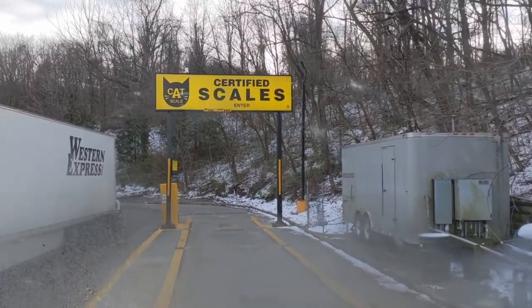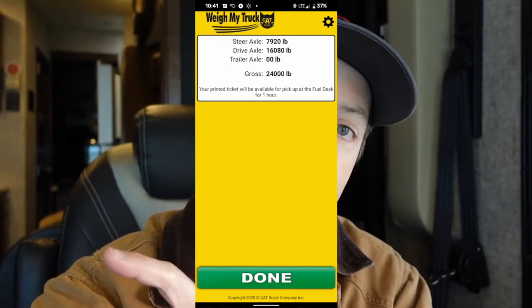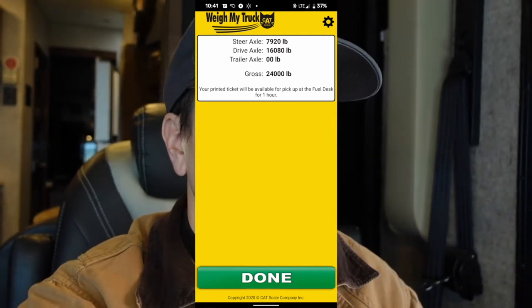When I went to the tire manufacturer's website, I found a chart that showed me based on the weight what the recommended tire pressure should be. Here's the key: you need to weigh your coach. This is a good safety thing to do anyway so that you're not overloaded. It can be as simple as finding a Cat Scale — a lot of truck stops have them, there's an app you can load on your phone. I drove up to the Cat Scale at a truck stop, pulled open the app, parked on the designated spots, hit the button, and I got my weights. What I discovered was, first of all, that I'm not riding overloaded — but second, that I took that weight, compared it to the chart on the tire manufacturer's website, which in my case was Michelin, and I'm pretty overinflated on my tires.